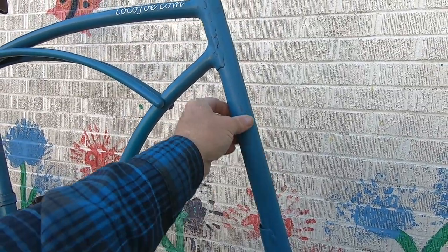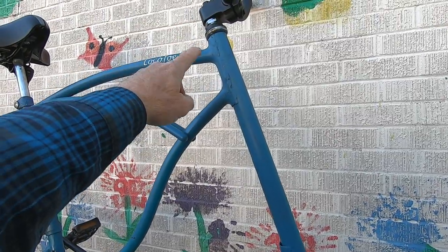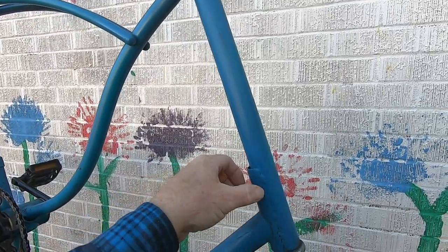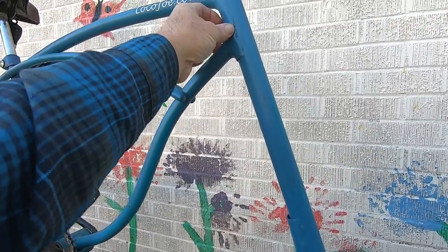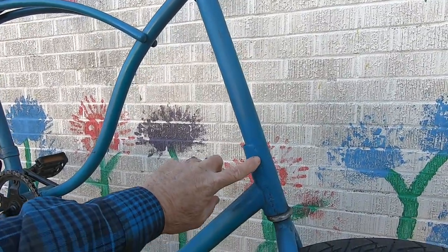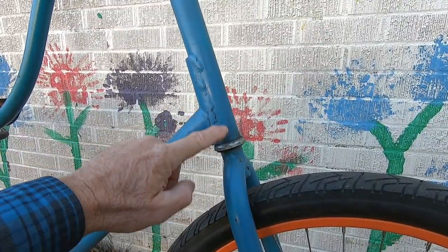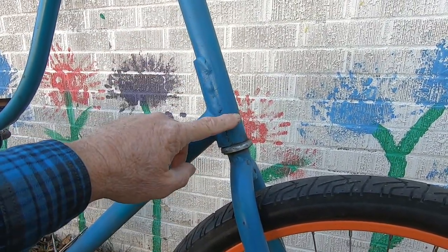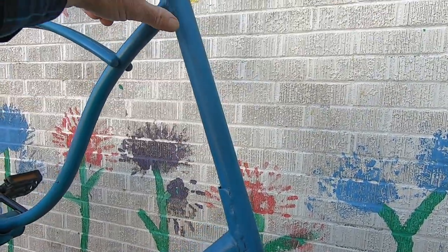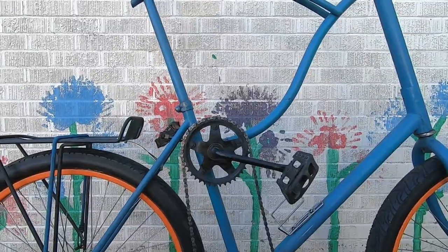As for the head tube, I just sliced the front halves off the original head tubes. I had this piece of pipe that I found on a bike ride one day — it just happened to be the right diameter — and I welded it into these C-shaped original head tubes. For no better than a welder as I am, I figured this was the best way to get the most weld on. I cut the original steer tube roughly in half and then extended it with a pipe and put the top threaded portion up here.